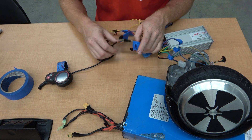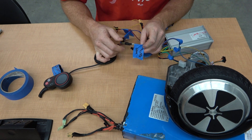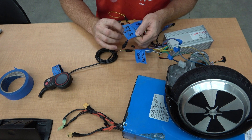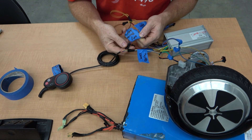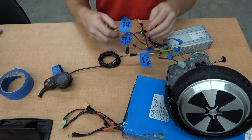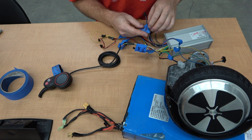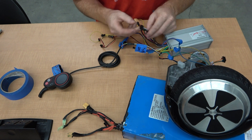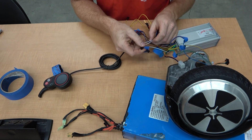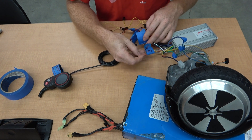You have two plugs designed for throttle control. One is a two-wire one, green and white, and green and yellow — that's the communication itself. The three-prong one is 60-volt power, ground, and trigger to turn on. You have one listed for lights. You've got the main power coming in, eco and boost mode to be selected, the brakes, and the plug for communication. You have two white wires for motor learning — forward and reverse learning. You also have a brake light.